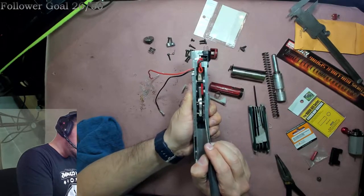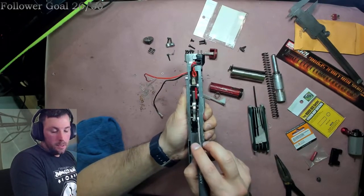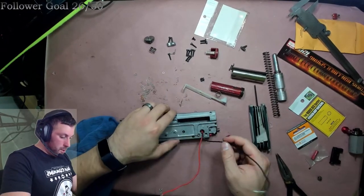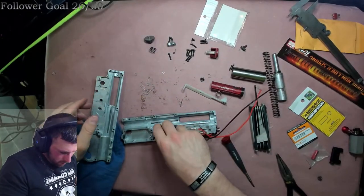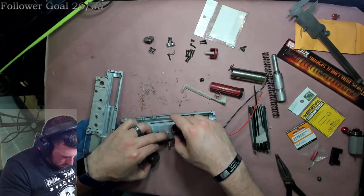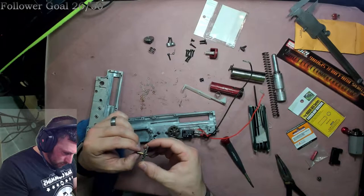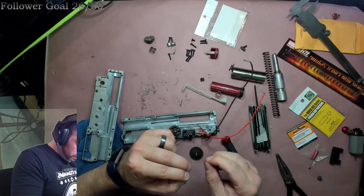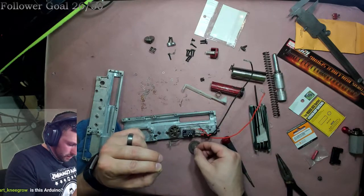Alright, so this isn't moving, which is good. And it's loose enough where I think I'm going to take the thinnest one off of the top. I'm going to put it on the bottom to lift the gear just a touch. And then I'm also going to take another one of the really thin ones off of the top entirely. And I think that'll get us right about where we want to be. So one really thin one goes away. Rest of these go on the top.